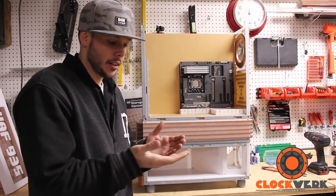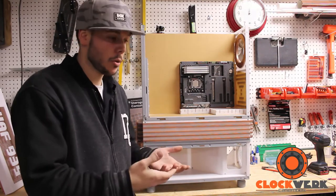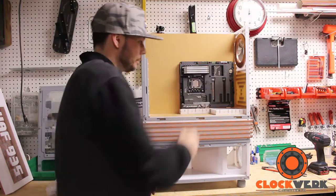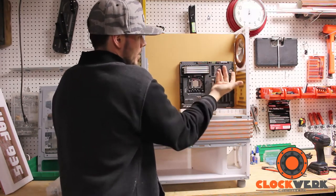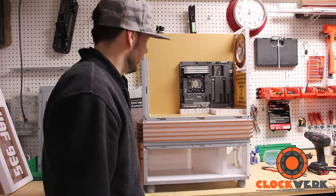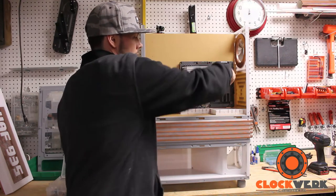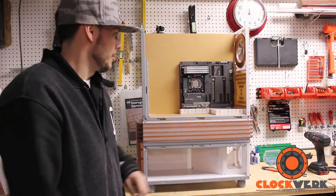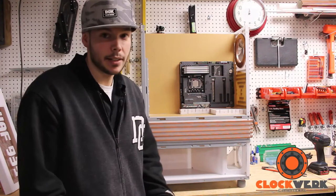I'm basically going to take the graphics card, the metal bracket that mounts it in the case normally, and bend a 90-degree angle flat, and then bolt it right into here. Because the graphics cards are going to be rotated and mounted with the face out, so it's like a 90-degree tilt, and they'll be run with PCI Express riser cables through the back here. I also have to make a little acrylic panel to cover the cables and have something for the graphics cards to plug into. So I'm going to probably add that to this video as well.